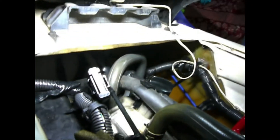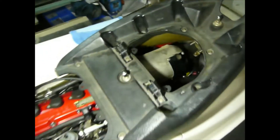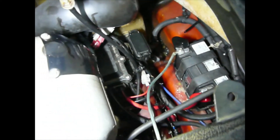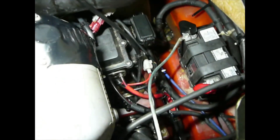The ECU is up in under there. This is an extra earth cable that can quite often fix those faults, because a lot of the sensors work on a good earth cable feed as well, and sometimes the standard earth cable isn't good enough.